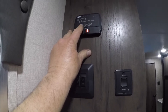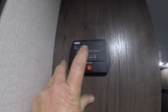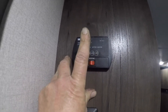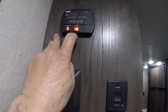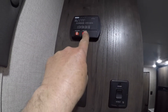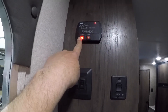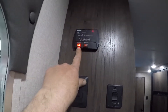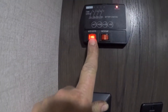The monitor panel tells you the status of everything: battery, fresh water, black, and grey. This is your water pump — if you're carrying water on board, this is what pumps it to all your taps, shower, and toilet. The water heater: this is where you turn it on. Make sure you have your propane bottles on beforehand, and that's where it will light.